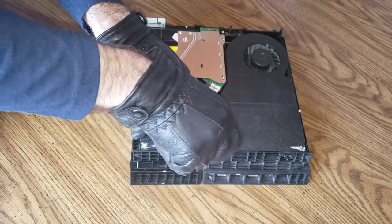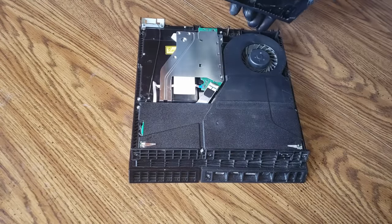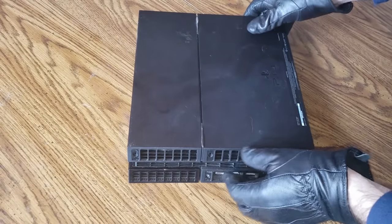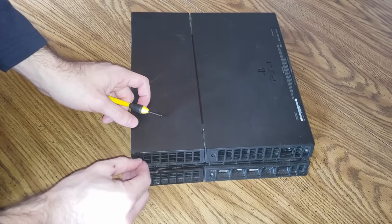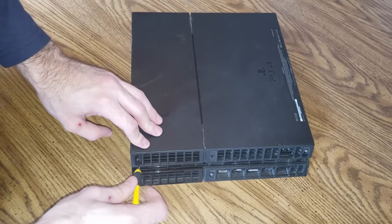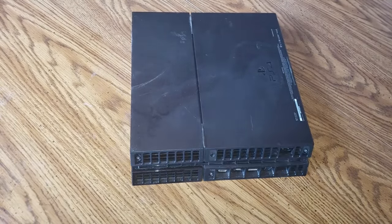Especially if you're using a very cheap flathead screwdriver. So the screws are in, everything's tight enough, they're snug. Let's go ahead and get that cover and put it back on our PlayStation 4. When putting back on the cover, start near the power button first and then bring it down towards the rear of the console — the cover should lay flat lining up with the screw holes. Then remember there will be three smaller black screws for the rear of the console; these will be T9 screws once again. So once you have all these screws back in you will be good to go to start up your PlayStation 4 again.